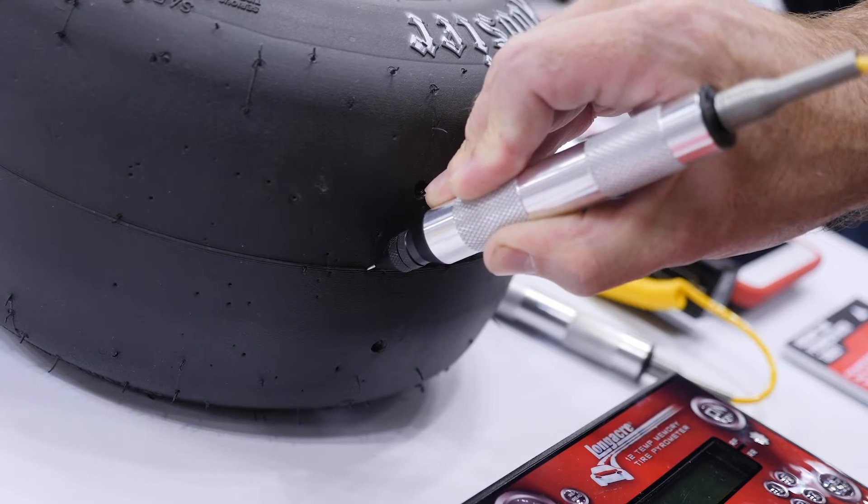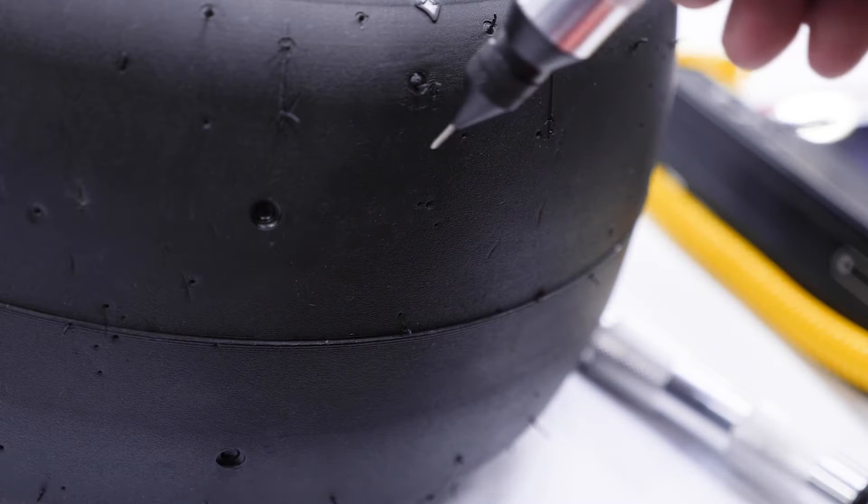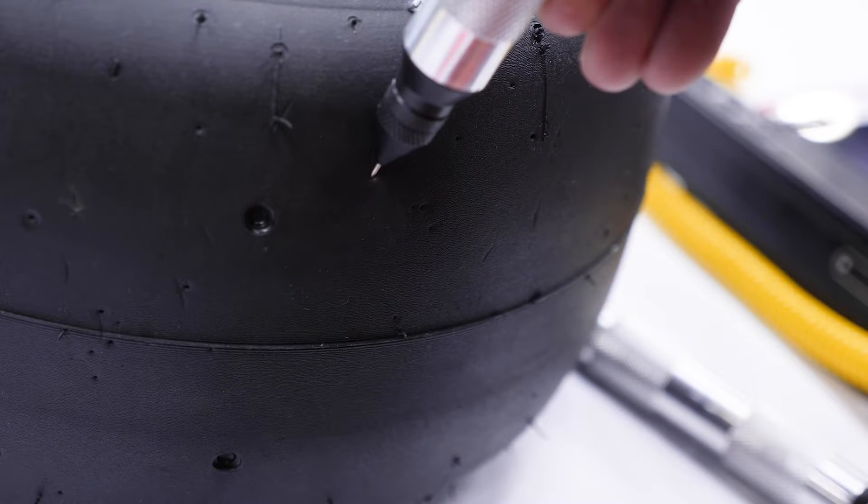For example, if we're using something like an infrared thermometer to read the tyre tread temperature, then this temperature on the tread is going to stabilise or equalise very quickly as the car comes off the racetrack, meaning that the data we're going to read is not that useful. Because we're reading the tyre temperature below the tread, it gives us a more realistic idea of what's happening out on the track.